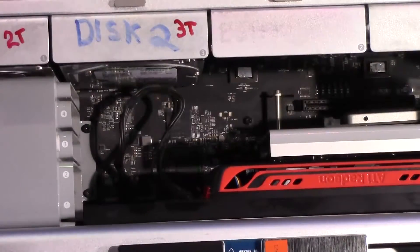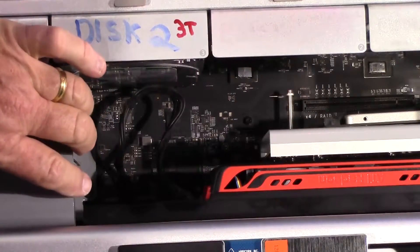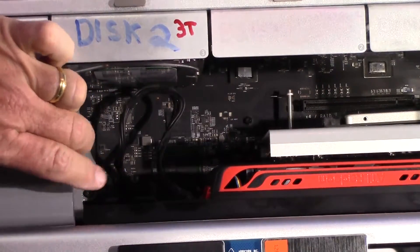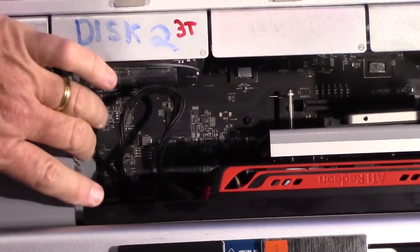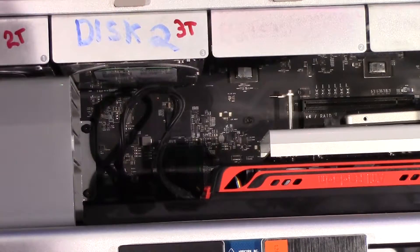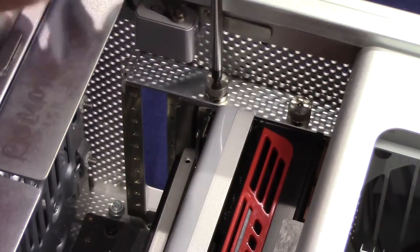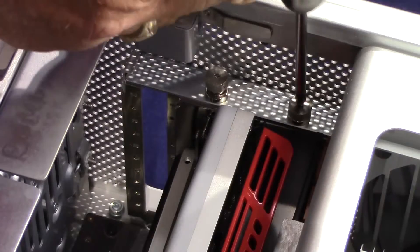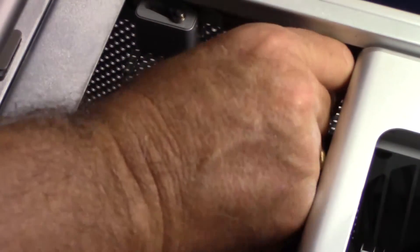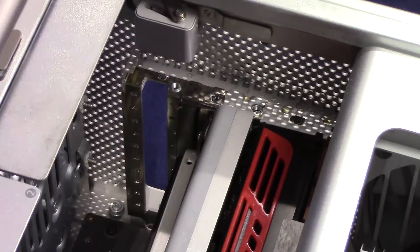Next, you need to locate the locking bar. This arrangement may be a little bit different depending upon what model you're using, but everyone will have a way of moving the locking bar backwards and forwards. In my model, this is a little button located on a big plastic cage. If you move the plastic cage backwards, it disengages the locking bar. Now you need to remove the locking mechanism which holds all the cards in place — this is normally a small bar with two thumb screws. Disconnect the two thumb screws and remove it, and then you will have access to the cards.